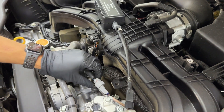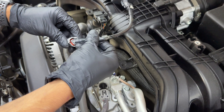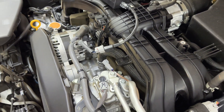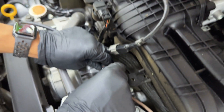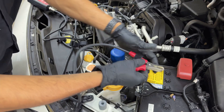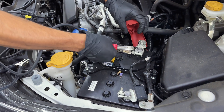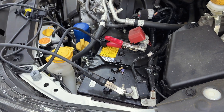With the engine off, you'll want to get in between the system controller and the AC compressor control valve. You can accomplish this by simply unplugging the compressor valve connector and plugging the vehicle harness into the RobinAir vehicle harness module. Next, you'll need to plug in the RobinAir EVDC 100 harness into the AC compressor, and then attach the battery positive and negative cables to the 12-volt battery on the vehicle or to a jump box if the battery isn't easily accessible.